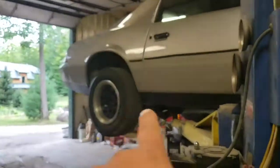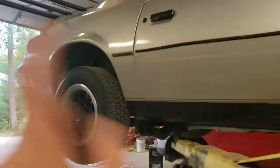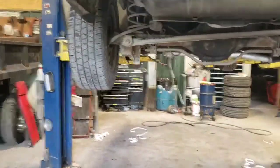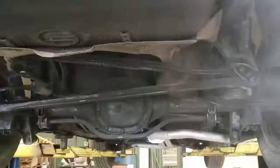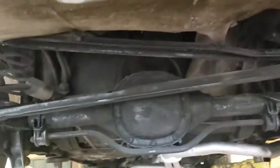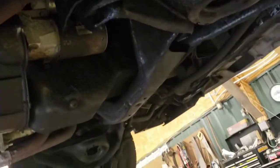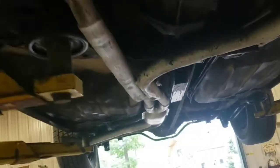We're gonna get the wheels off it — the underneath of this car is in really, really good shape. So we're gonna give her a little spritz of black paint just to keep her looking nice and keep her from going any further. Now the trick with this undercoating is you just want to do light spritzes — you don't want to really hammer it on there. This car's already been undercoated its whole life and it is in good shape. You just want to black everything up to highlight that it's in good shape. You don't want to hammer that undercoating on it because if you ever try to sell the car, somebody might get the impression that you're trying to hide rust, which isn't the case.